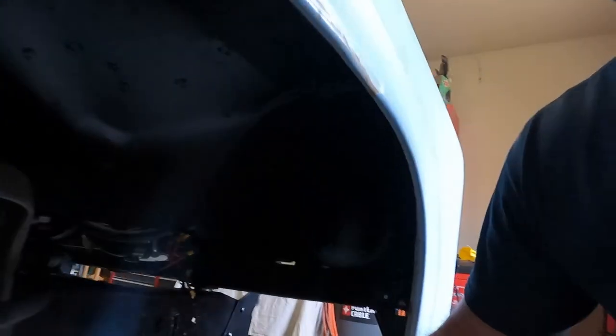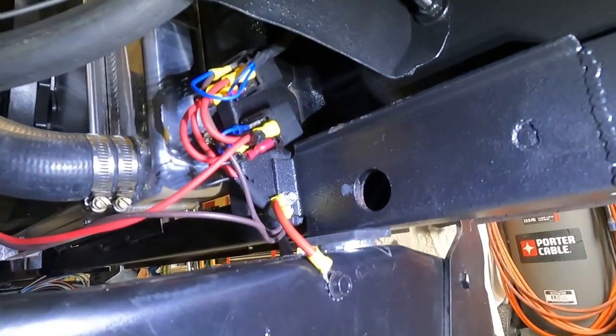The complicated part is when you have to run a setup like this. The reason that exists is the Holley sends a ground trigger output when it reaches temperature. The air conditioning system, specifically the Restomod Air Bantam, sends a positive output when it's time to turn the fan on, in case you turn on anything to do with defrost or air conditioning. So you can't use the same relay. You've got to figure out a way to do both. So basically I ran two independent relays and then tied the output from both relays to the fan power. Hopefully that takes care of what we need.